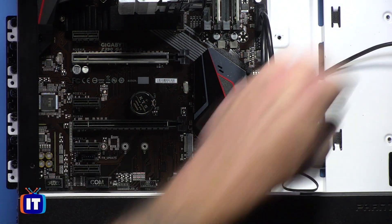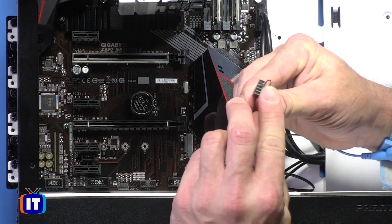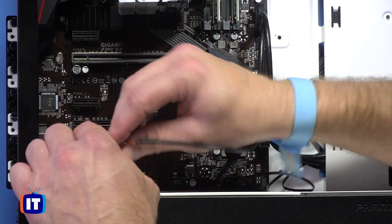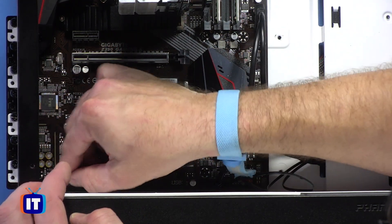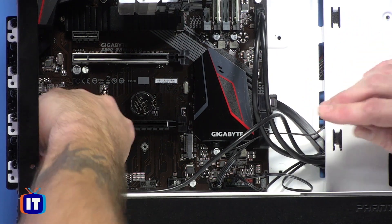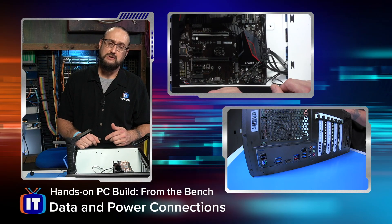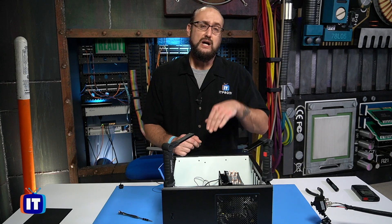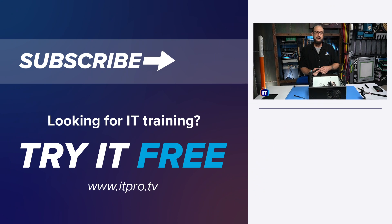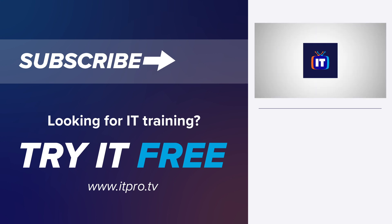Moving down the line, one of the last ones we're going to connect is all the way over on the other side — this is your high-definition audio connector. You'll see this actually has a pin that's missing as well, and that lines up to the pin that's missing inside of that connector. I'll just click that in place — you can feel it go right in, and it's perfect. These essentially are our connectors. In this episode, we looked at the main power connectors, the CPU power connector, USB 3.0 audio, the front audio, the front panels, the hard drive light indicator, and the power button. We've made our connections — that's how you do it when you build your PC. Thank you for watching ITProTV.